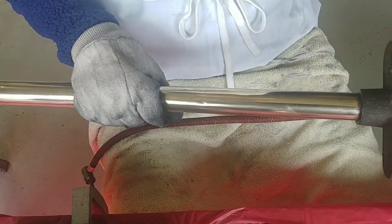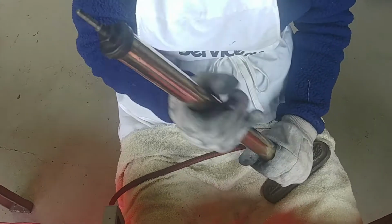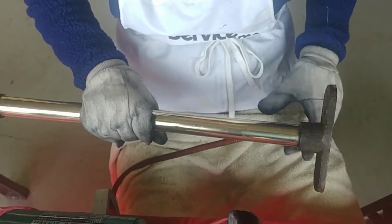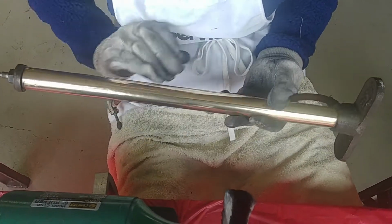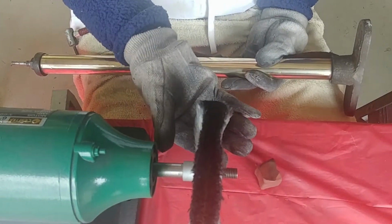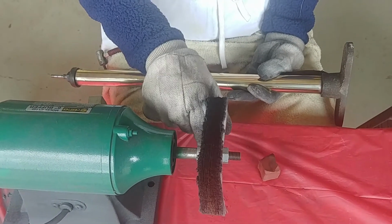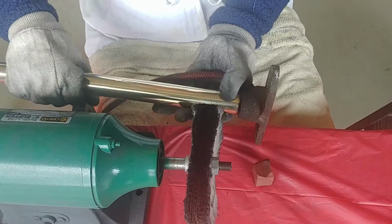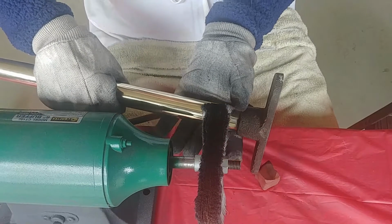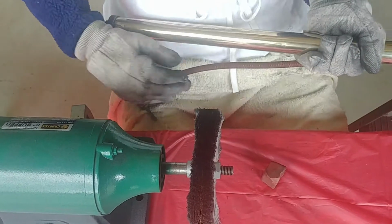Always use a pair of cotton gloves when you're working on your wheel, and that's also nice for rubbing the excess polishing compound as you work. The other thing I'll tell you about polishing is you have to be really careful that this machine doesn't whip your item out of your hand. So always try to keep it going. How do you describe that, Harry? Keep it going down so it doesn't grab it and whip it away from you.